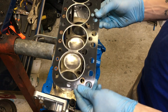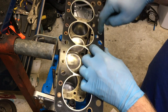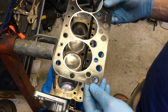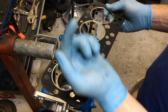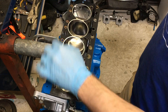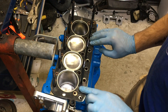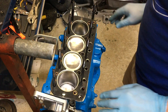The first thing that you're going to need is your head gasket. The head gasket is the seal that helps seal your pistons, all of your lifters, everything separate from each other on the block, in between your block and the cylinder head. It's important that this goes on the right way and that it is tightened down properly. This cylinder head gasket has a little indicator where it says 'top', so that's going to be facing upwards. This only fits on one way, so you slide it on like so, sliding it all down at about the same rate. Make sure all the holes line up — anything that should have a hole has a hole lined up and you're all set.